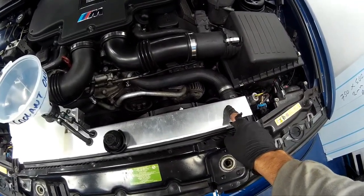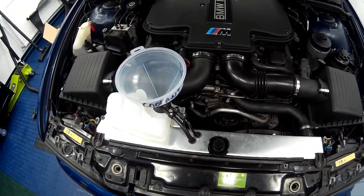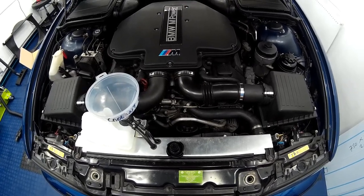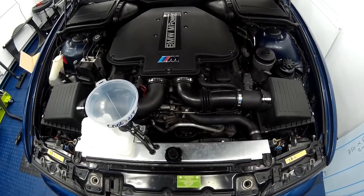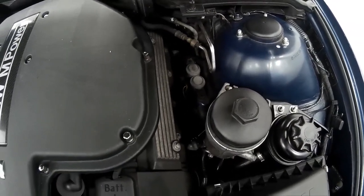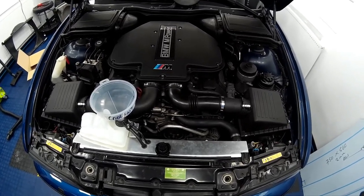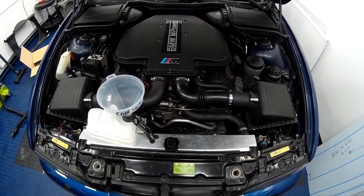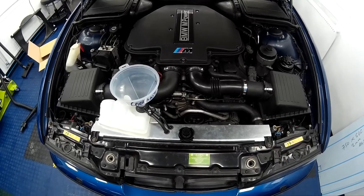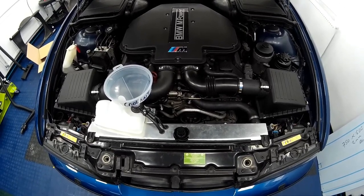The M5 is a self-bleeding system — the little hose on top of the radiator goes from the highest point of the coolant system to the header tank, so you should be able to slowly fill up the system and self-bleed with just the ignition on, the internal temperature turned up to full, and the cabin heater fan on stage one. This opens the coolant solenoids and allows the little pump to flow coolant through the system. Once done, run the engine up to temperature with the expansion cap on, allow the fans to kick in, let the engine cool down for a couple of hours, then top up the coolant as required.